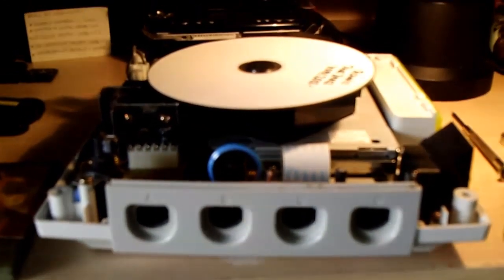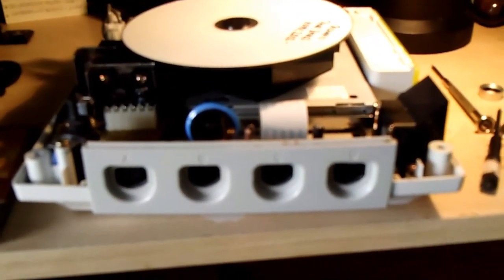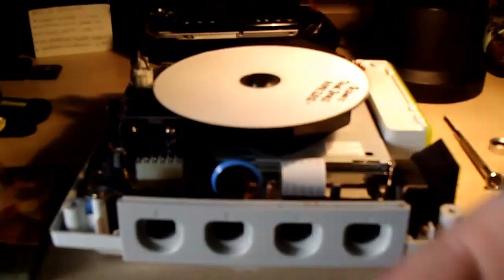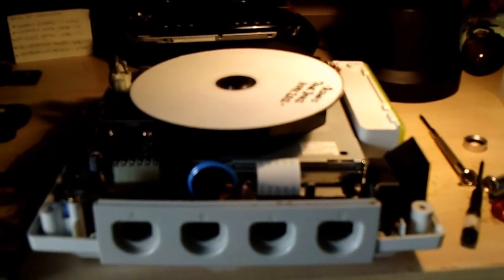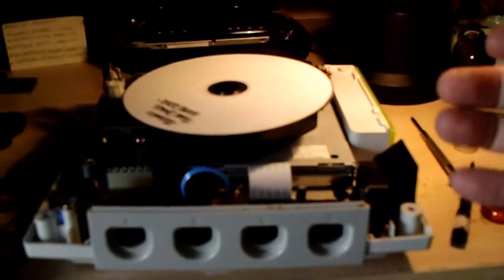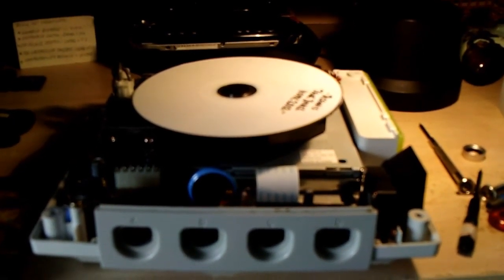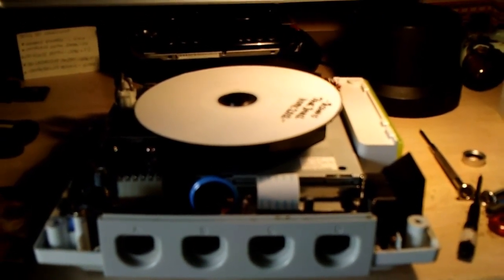But I wanted to pass the information on, because really the issue with the ports on the Dreamcast being burnt out, or the Dreamcast constantly resetting when it shouldn't, strangely enough, has something to do with cleaning the pins on your power supply. I know it's really weird, but I think it's an overheating issue. And all these things, disc reading errors, if the disc is spinning, then it's a relatively easy fix. And I urge you to seek out those methods, check out the links that I supply, get your Dreamcast up and running again for basically nothing, okay?